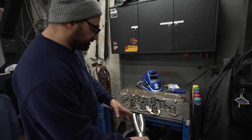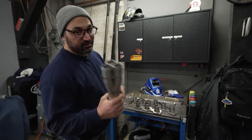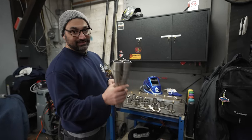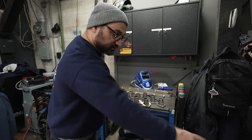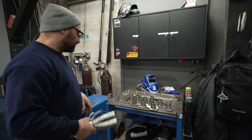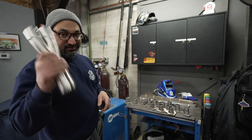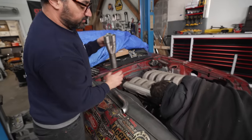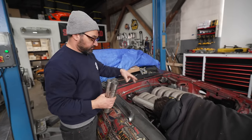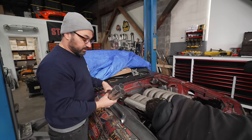So we're gonna now fit three tubes into three slip tubes. Everything is slip fit, which is gonna make this a little bit easier on us because we are not header making experts. And then from here, two tubes will go into one tube and out the back of the car. Sounds easy. When you see that Mustang and where this V12 fits in it, it's not. Well, let's get started. So we're just trying to figure out, again, we've got to go 6 into 2 into 1.